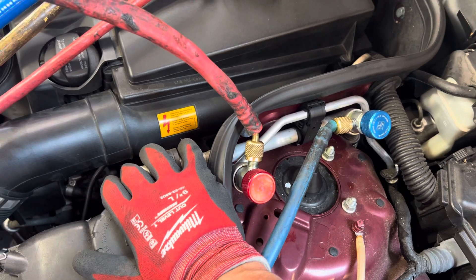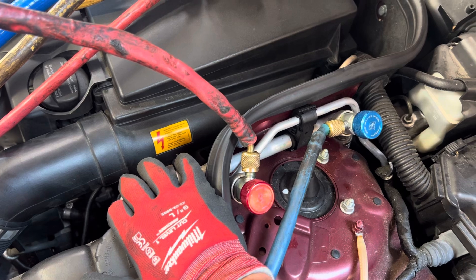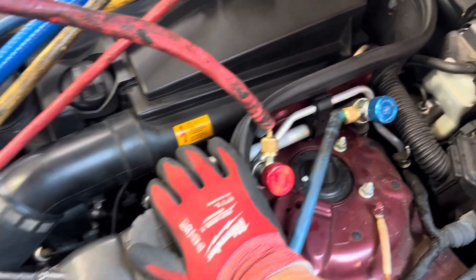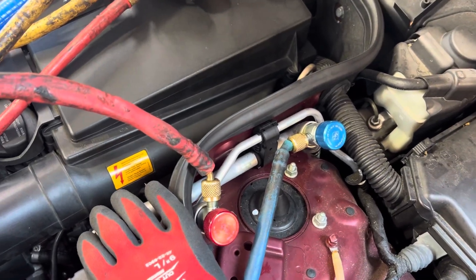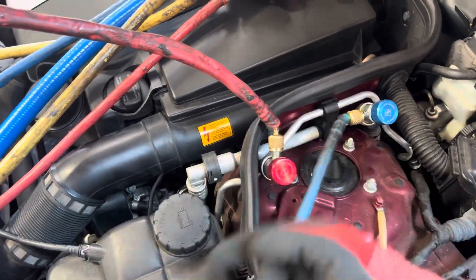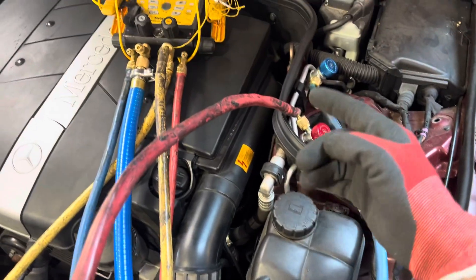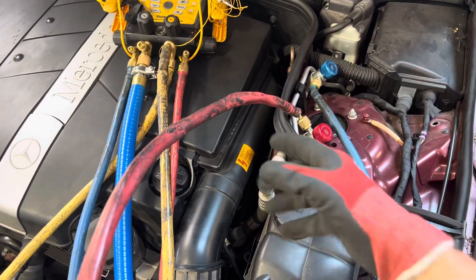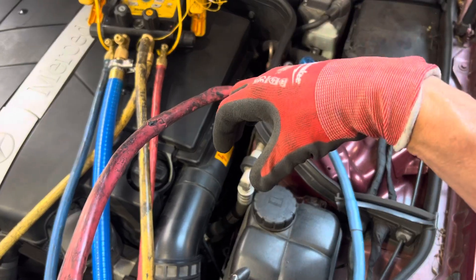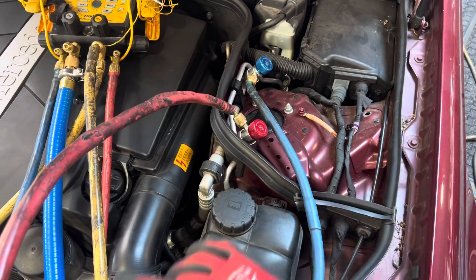This is a family member's car where the highest priority of cleanliness and doing it right apparently isn't the highest priority. That's okay — it's a learning experience for me, something I've seen over the last 40 years, 30 in my own business, where somebody tells me to do something not quite right. I get to see it come back and see how fast things wear out — it might last one, two, or three years. So long story short: the new compressor was poured upside down and nothing came out, and the old compressor also had almost no oil — barely 10 milliliters.